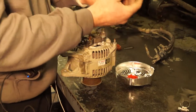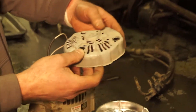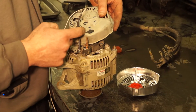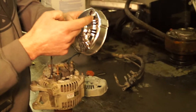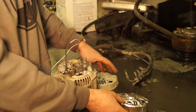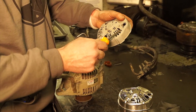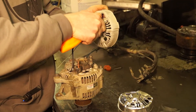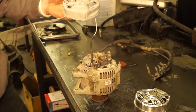Now on the back of your little tin shield here, the output post goes right here. You can see the output post is going to be there and then this wire is going to come up right out of this. This one I've already modified — you can see we just spread that out a little bit so that you'll have more room for the wire. I just take a screwdriver and kind of bend that out so that you have a passage for that wire to come up through.